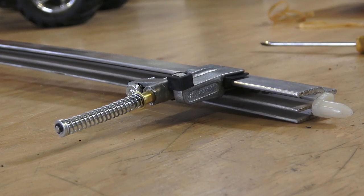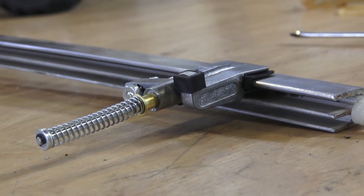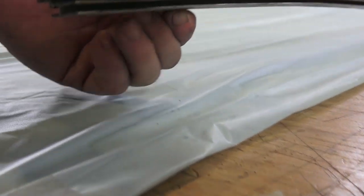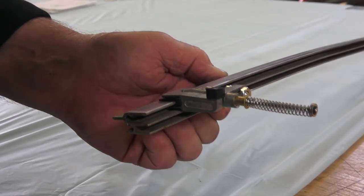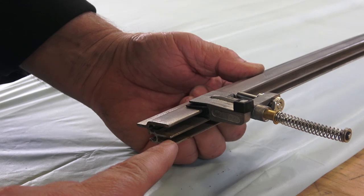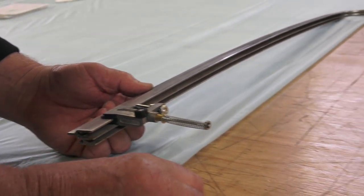This is chapter 3, the final chapter in the sunroof steel headliner installation. From the past video, we had the rails in the roof of the car but noticed that our cables did break. We had to buy new cables with the new sliders attached to them, so just make sure you position this correctly. Remember that bottom track is for your headliner slider.